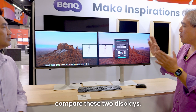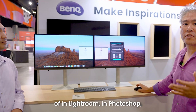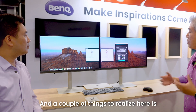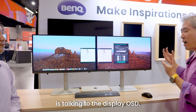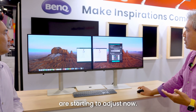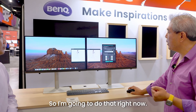Now we compare the two displays. The left is the reference, the right is the one we're adjusting. This one has way too much magenta — this is a color correction process very similar to Lightroom or Photoshop. I'm going to add more green because it's too magenta right now. One thing to realize: don't click super fast. The software is talking to the display OSD and making adjustments in real time, but it takes a moment to catch up. Go through it slowly. The colors are starting to adjust — the whites are getting a lot closer, though I also need to reduce the red a little bit to match the reference display.